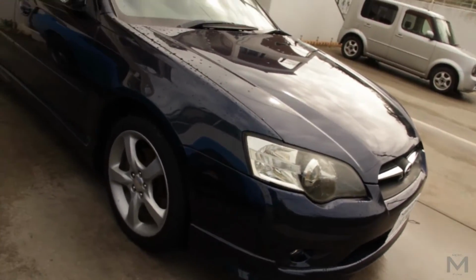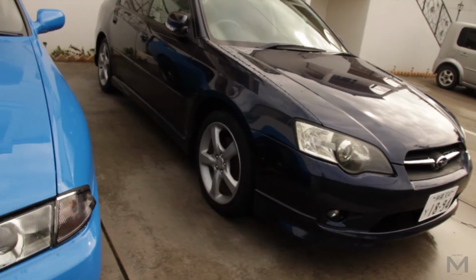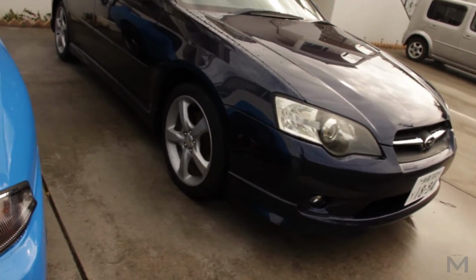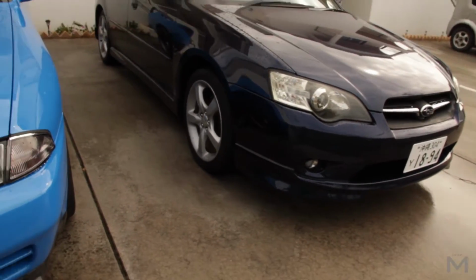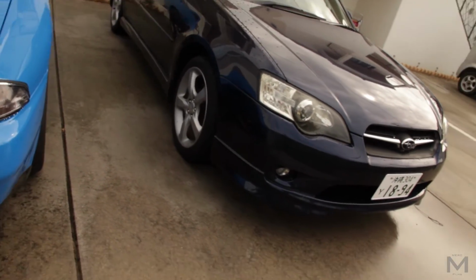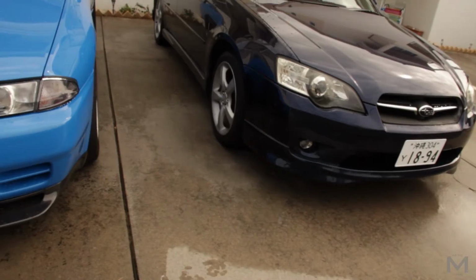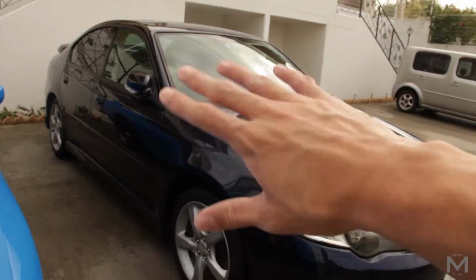Like I said, today I'm just doing some basic maintenance stuff. Adjusting tire pressure. I'm probably going to bump these up pretty high since they're just normal street all-weather tires, between 34, 35, maybe 36 psi. I don't want to do anything too crazy, and that'll give me room to bleed it out later if I need to. If I feel like I'm getting too much understeer, too much oversteer, whatever, I could adjust tire pressure accordingly. And it's just a stock Legacy. I'm not too worried about it.